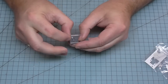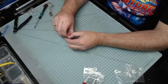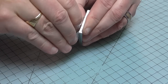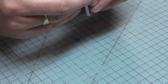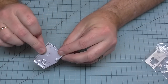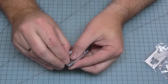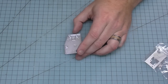Just like we've done from the previous doors, make sure that's pushed flush - we want it all the way through. I'm going to put a little bit of oil on the end to help it slip in so it goes all the way. There we go - that operates there as you can see. On the other side we're going to be pushing this gear into place. It's shaped so we just want to match up the shape, and when I turn the handle the gear moves - no problems at all.